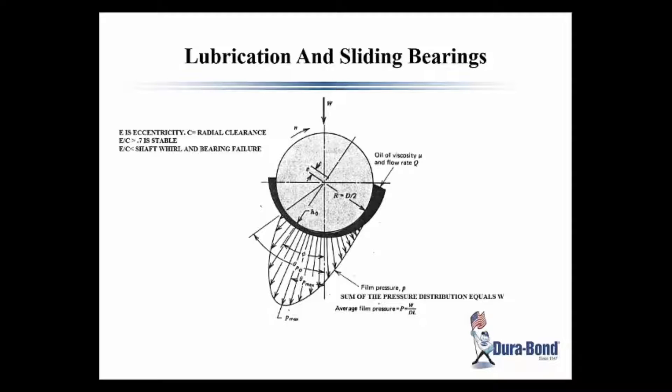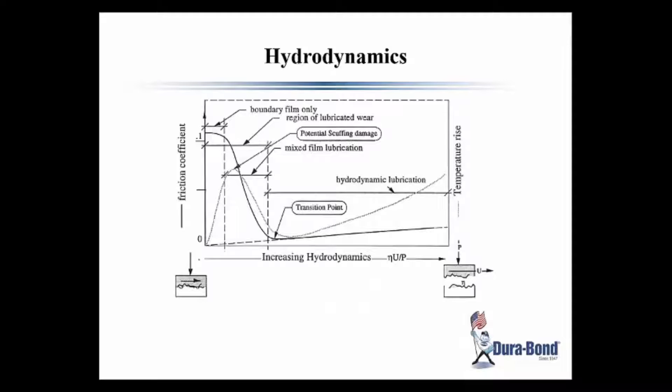This is a simple diagram of one cam position. The E in the center region is eccentricity. The shaft must move off center of the bore centerline to form an oil wedge. Without eccentricity the oil film will not support the load and wiping of the bearing is likely to occur. Most casual observers will note this is a single cam bearing, and the block cam bearing bores must be in close alignment to get the eccentricity for the oil wedge to form. The minimal oil film thickness is approximately two ten-thousandths of an inch in late model engines, and the eccentricity is on the order of six ten-thousandths. Note that engine pump pressure is not required for an oil wedge to form — only flow.